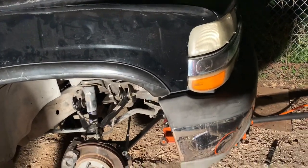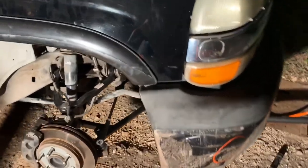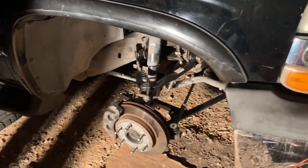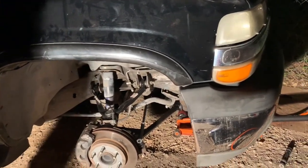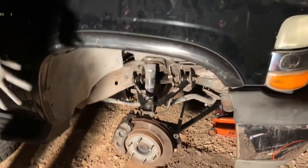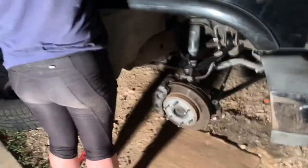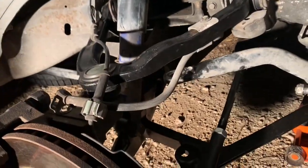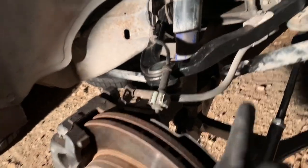This side's done already — we're just going to tighten everything down, double check everything. The only thing I'm not going to plug in right now is the sway bar links, just so I have play on the other side so that the sway bar is not in the way. That'll be easy to put on tomorrow. Other than that, this side's done — upper, lower, inner and outer tie rods, and a new sway bar link as well.